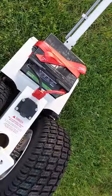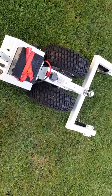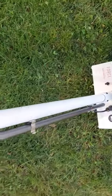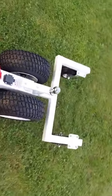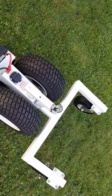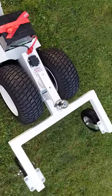I'm going to set the camera down for a minute so I don't damage anything. The connector drops right in that hole, it goes on, and as you can see it now adds stability. It's in freewheel mode right now, and it's got a low and high switch there. Your forward and reverse are right here. You just drop your trailer right on that ball and it goes. They say it's rated for a 9,000-pound trailer and 900-pound tongue weight. I get a 750-pound tongue weight, but the ball they sent me is only rated for 6,000 pounds. We'll see how it works — that'll be another video.